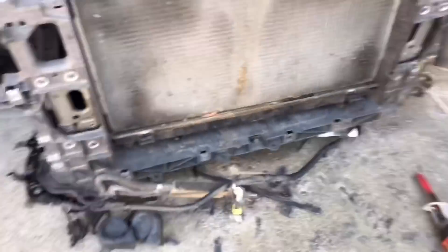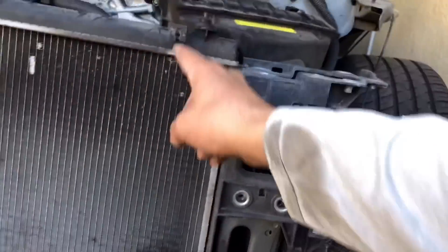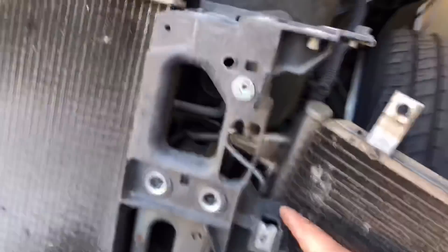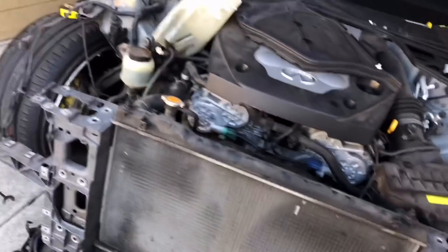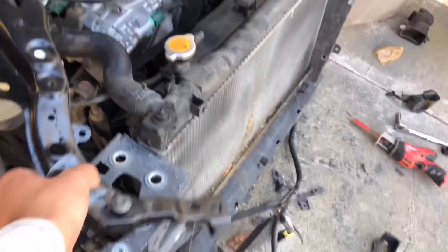Cutting the cross-piece off will cause it to lose some structural rigidity — it won't be as stiff as it should be — but this is a project car, live and learn. Now that the radiator support is kind of on, it still hasn't sat flush on the bottom because I need to make the new holes. I also noticed on G37 pictures that these lines go up around the side and onto this, so I'm going to try to relocate them through here. Looks like I'm dropping some fluid somewhere.